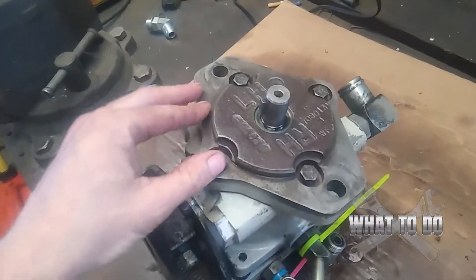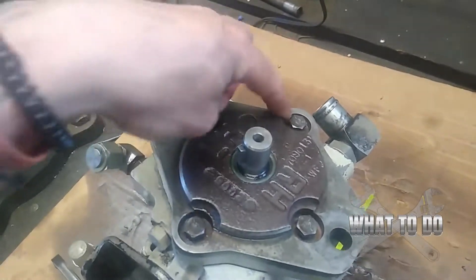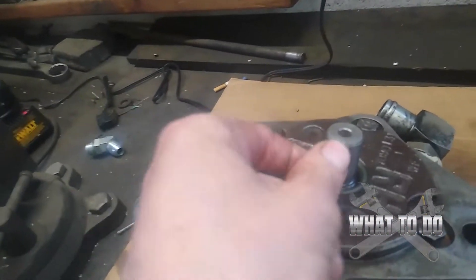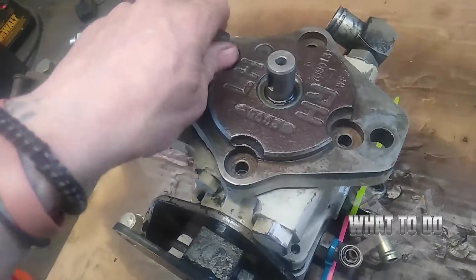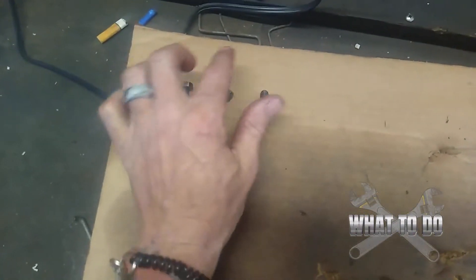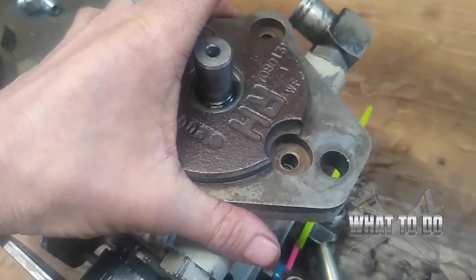The first thing you're going to do is remove the charge pump on top. Take these four bolts off, then get a screwdriver and pry out the keyway — or you may be able to pull it by hand. Set the bolts down in order, because that's the way you're going to put it back together. After the four bolts and keyway are out, slide the charge pump up slowly.